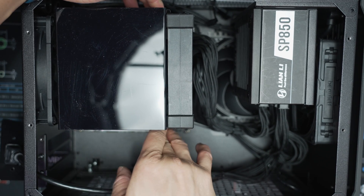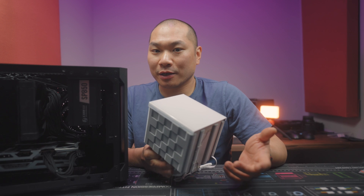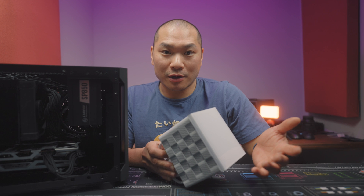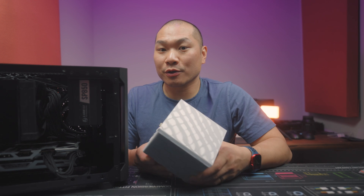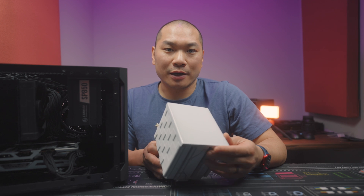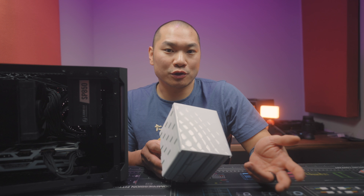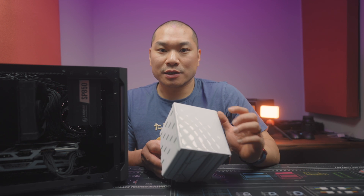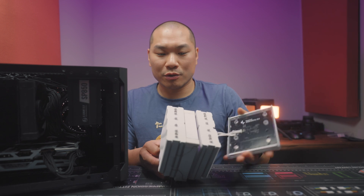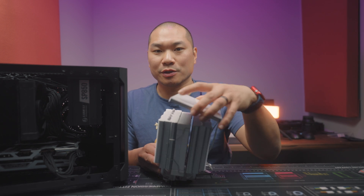The entire assembly, assuming you're able to mount the fans flush or lower than the display, is 162mm on spec, and I measured it just a tad over that. It is a bit on the taller side for a 120mm fan tower. The display does add a bit of height — for example, the Scythe Fuma 3 measured in at about four millimeters lower. The heatsink itself is only 157mm, so you do lose a bit of compatibility by having the display — that is a trade-off.